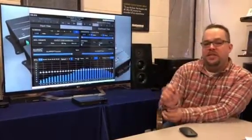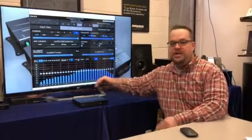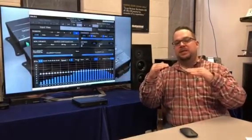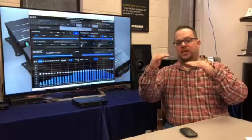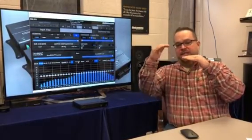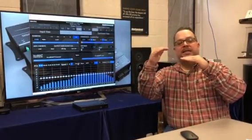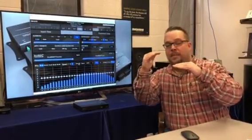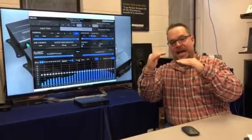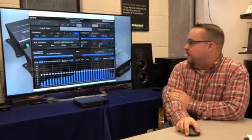My track is looped and AccuBase is now not active. At this point I'm going to go to the source unit and start turning up the volume, watching my RTA to where I start to see the bass plateau or reduce. As you're voluming up, you might see the mid-range come up while the bass frequency response doesn't — that's the point where you stop, maybe even back it down a little to make sure they're more closely aligned.